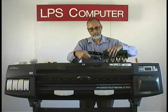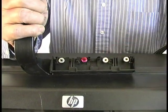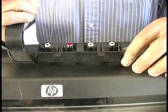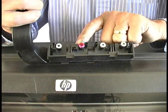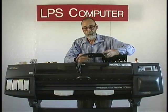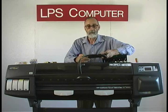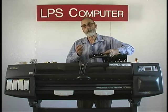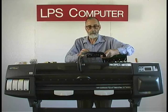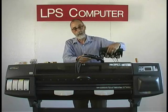You also see on this one, on the printhead ports, that the cyan seal here has failed. There's a seal here that has two purposes: one is to seal around the needle when you insert the printhead. When the printhead is taken out, there's a check valve that's supposed to keep air out and ink in. This check valve has failed because ink is getting out even though there's no printhead present.